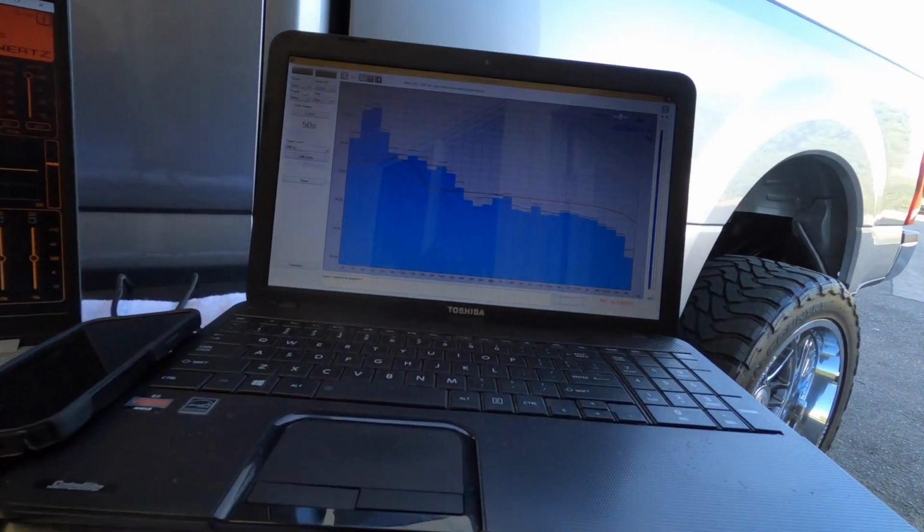So we had to make some adjustments. I actually had the inputs wrong, so it had no bass. So I went back through, corrected the inputs, got the signal right, and got everything else going right. Then we got everything to turn on correctly the way we wanted. And the system itself, we RTA'd, that's what it looks like.